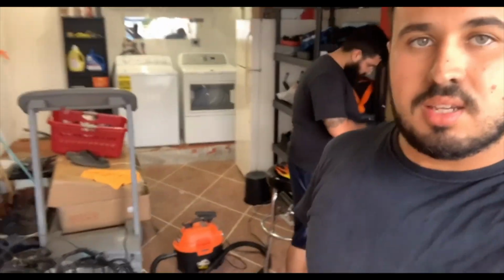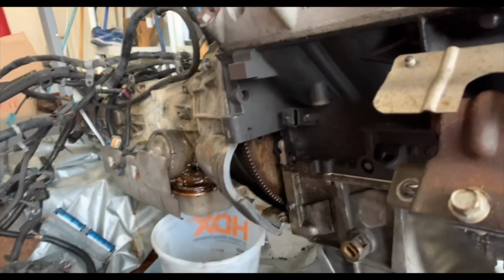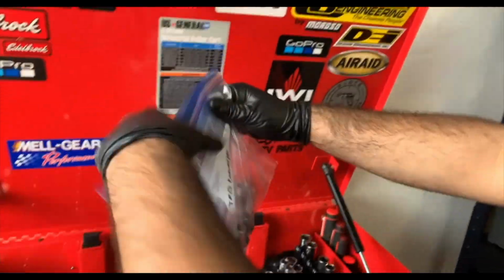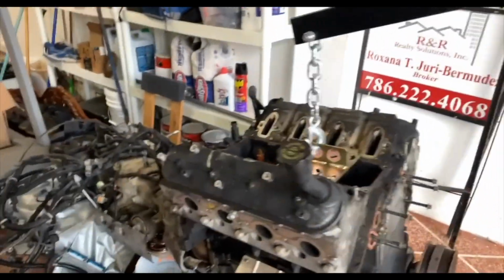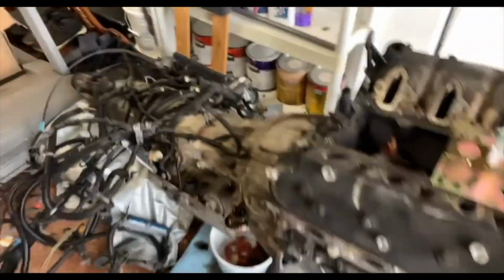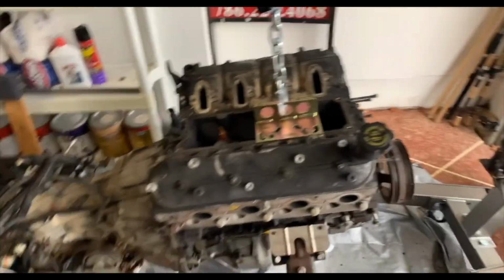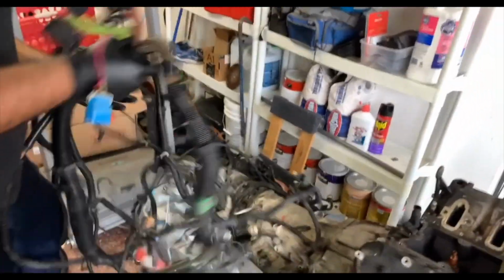All right, guys, a little update here. The torque converter bolts, 3 of them, came all out, easy peasy, lemon squeezy. Look, everything over here is labeled. We got to be as organized as we can, we don't want to lose anything. Got to take the bell housing bolts now. We have the crane, the cherry picker, already here, and we're going to separate it. We have all that harness, all that weight reduction.